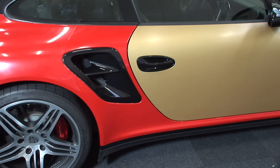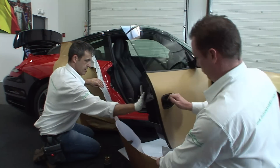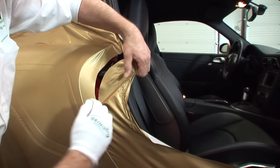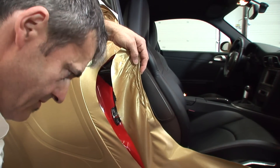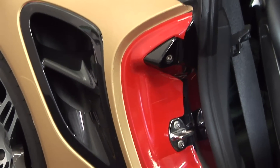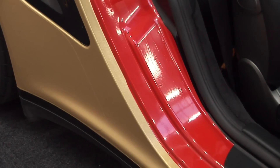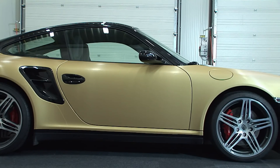If you want to apply an automotive and deco film on a car with a very contrasting colour — as demonstrated on this red background — we advise you not to wrap the complete side of the vehicle with one piece of film. Use separate film parts for each panel so that you can apply the film completely around each edge. Afterwards, the red background will no longer be visible. Attention: each piece of film needs to be applied in the same direction; otherwise, you'll have colour differences.